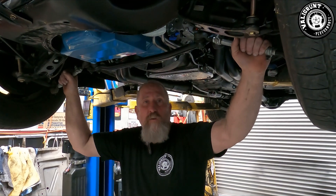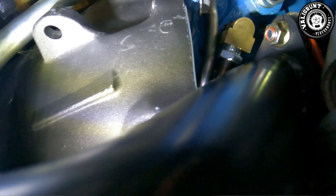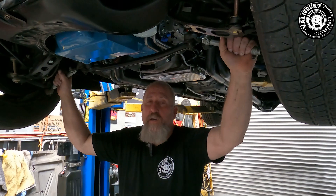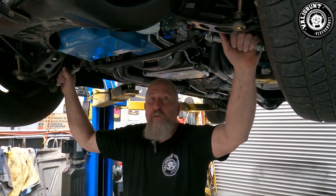Another reason why you don't want the oil filter sitting on top of the engine is that this engine in particular had at least two or three seconds — sometimes less — before the oil pressure comes up. So you get that nasty little tick tick tick every time it has to pump. Now having the oil filter underneath, the oil filter always stays full — it cannot drain back because it's sitting at a reasonable level with the sump. Another reason we do the oil filter relocation is because the original valve in the oil lines has a bad habit of drain back.